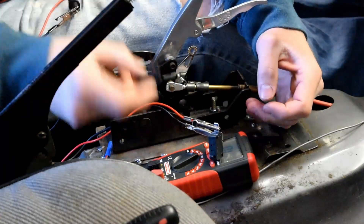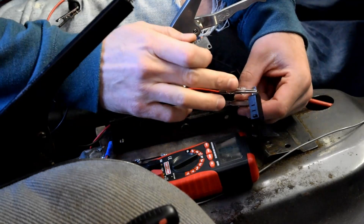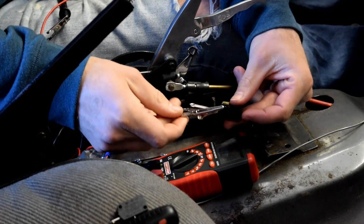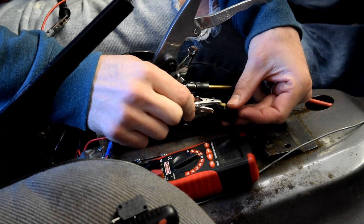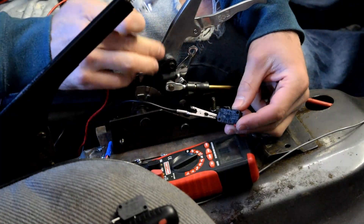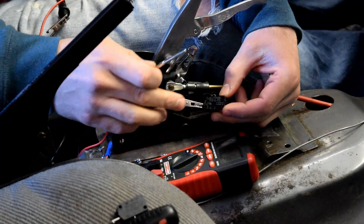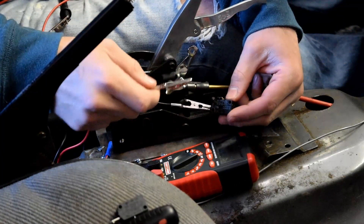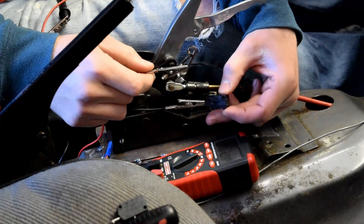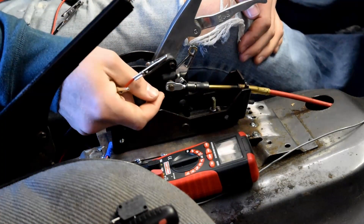There are also different switches that look a lot like it, but you can't use just any switch that looks similar — you'd be wrong to try. This other one is already connected without hitting the switch, so if you use one of these, you won't start in park and you'll actually be able to start while in drive, which is the exact opposite of what you want. So be careful what switches you buy. I'll leave a link for the correct ones down below. I'll be using the B&M micro switches.